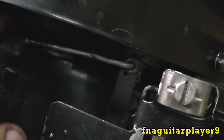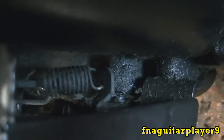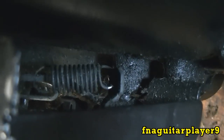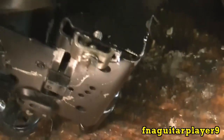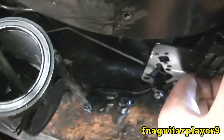You see another little hole here where the other end of the spring — which is broken — is supposed to connect into. You can see the governor arm here, the top part of the spring right here, and it hooks down to this lever down here which is what sets your throttle. That's how the tensioner works on the governor spring and the governor arm. On some of these you'll have different holes for the governor spring on the governor arm — you just have to pay attention to how it was, as some of them are different.